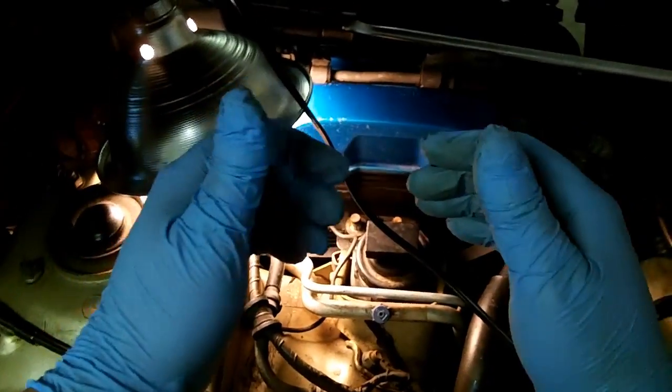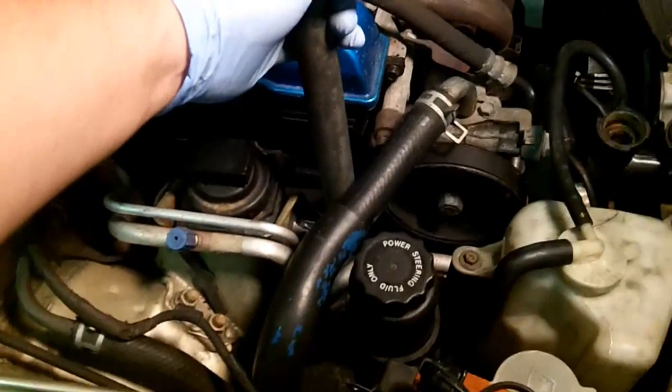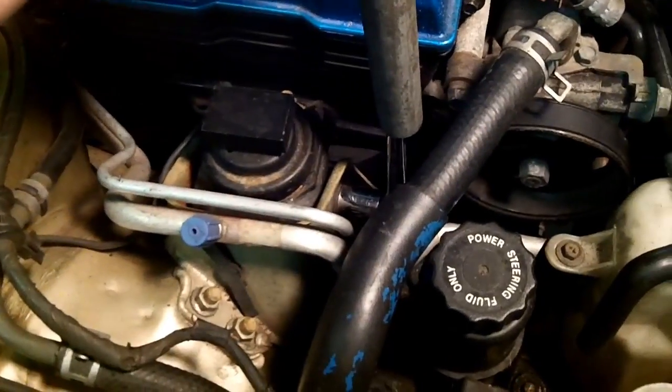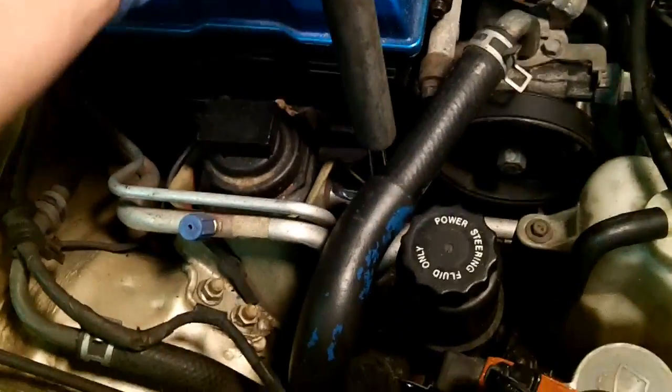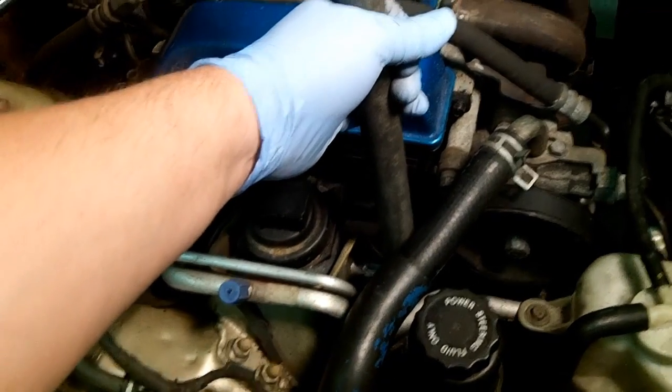That way you don't have to worry about doing 2 wrenches, you know, one of those kind of things. You don't have to worry about that. Here's what I'm doing. I got my ratchet on there with a 17mm, just my tiny little ratchet. I got a cheater bar on here. This is a 3/4 inch cheater bar, and I have broken bolts loose like this before, but there's a very good chance that I'm going to break my ratchet, and if I break my ratchet, that's it. This is the only ratchet I have.